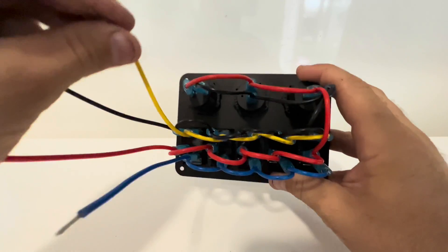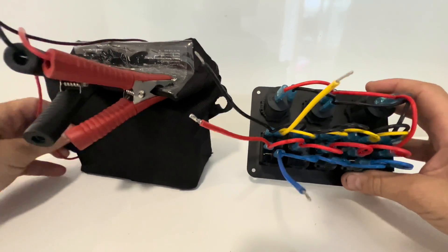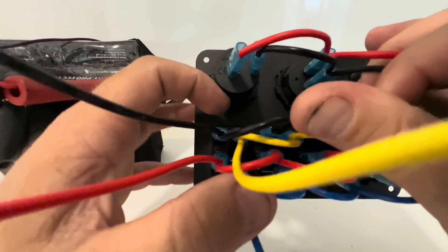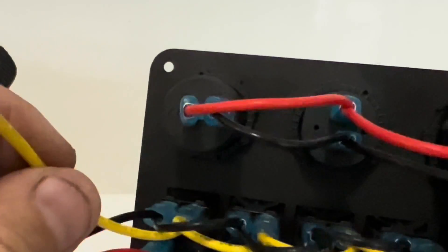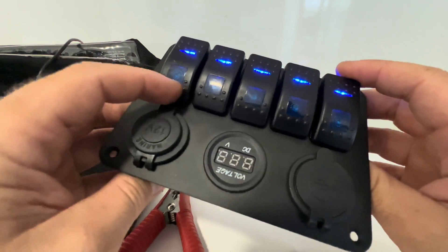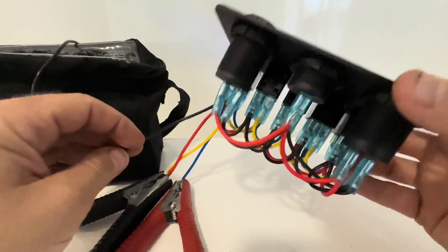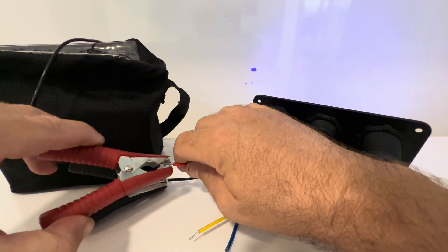I've got this little power pack here, but even if you just got some alligator clips off a 12-volt battery that's pretty good too. Starting with the lighting side — these two earths are both on the top of both switches. So even though that's yellow, the two sides split: earths on the two top pins. Earth to that one, positive to the blue on this one — voila. So when the headlights or parkers are on you can see where the switches are. That's all that circuit does — provides the lights. It's not essential; you don't have to wire this side up if you don't want the lighting.